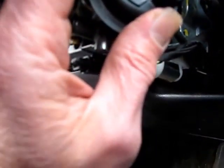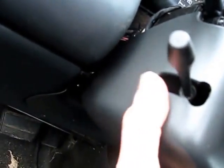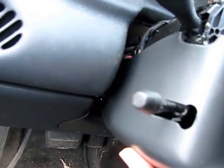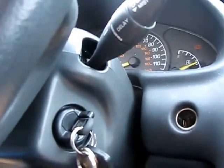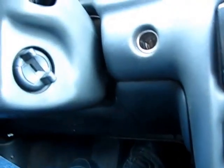At this point the key is out and it's back in normal operating condition, putting the covers back on. I used a file to open out the slot so the tilt lever would fit back through it — they made the slot so narrow you couldn't get it off. I'm not worried about a little cosmetics there. We fit the top half on, snap the two pieces back together, ratchet the three T25s back in, put it all back together, shut it down, put the key back in — thanks for watching.